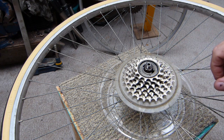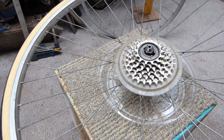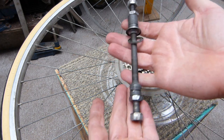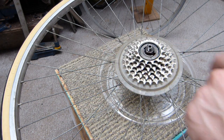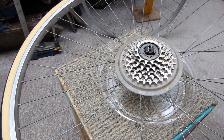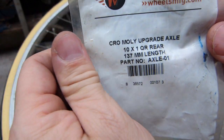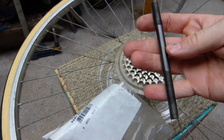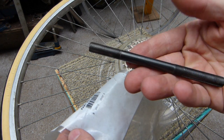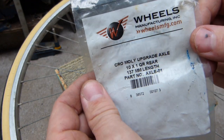For contrast, I also have another wheel over there — same cup and cone — but I'm going to use that as well because it has dry components, whereas everything out of this one is going to be greasy. I already assembled it because I changed the rear axle and had a test fit on it. The new axle is a modern material. It's a chromolybdenum steel, a stronger axle, because the old one — which is in my hand — kept bending. It's black and it's medium carbon steel, so chromolybdenum steel is going to be stronger.